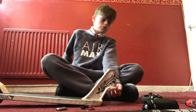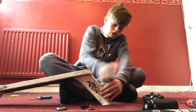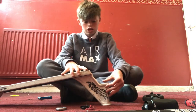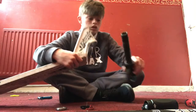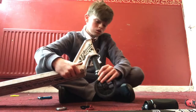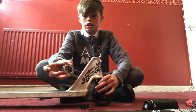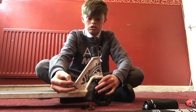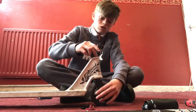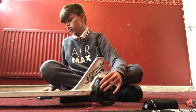Let's get into this build. We're going to install the top part with the fork and the headset. I'll get the bottom part of the headset in — there we go, the headset is in on the bottom half. I've got the crown race already on the fork because there's no built-in crown race. The headset with the top crown race is going to be put on, then this slides on, and then the top cap slides on face-in first.